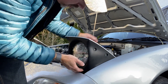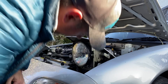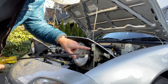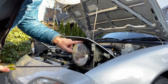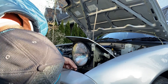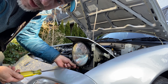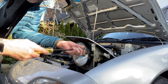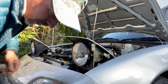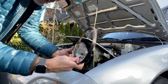Once we've got those off, we can stretch this out a little bit and then take it off. That gives us access to the next screws. I'm going to use a longer Phillips number two — I need it for the one on the bottom. There are three of them in total that hold the retaining ring on. I'm going to back them off but not take them all the way out, because if you do they fall and go missing, and these are not like any other screw on the car. Once you've got those loose, you can remove the retaining ring.